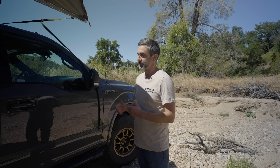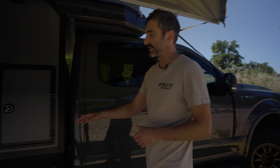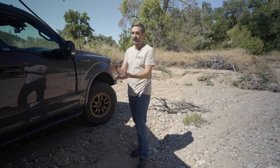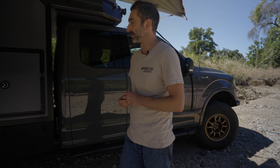Going into the truck itself — this is an F-150 half-ton and the camper weighs 1,300 pounds. From a suspension standpoint, we've only had to do a single add-a-leaf, with the Bilstein 8112 suspension up front — lifted a little in the front and a lift block in the rear just to level it up. The truck is well within GVWR, and you have a 200-pound weight savings from removing the bed, so the net weight is about 1,100 pounds. The truck still handles and rides great without extensive suspension modifications. On a three-quarter ton F-250, you could just drive it away without any modifications at all.